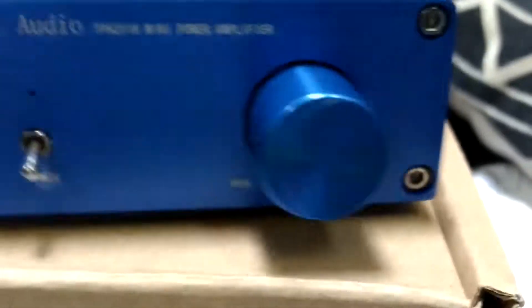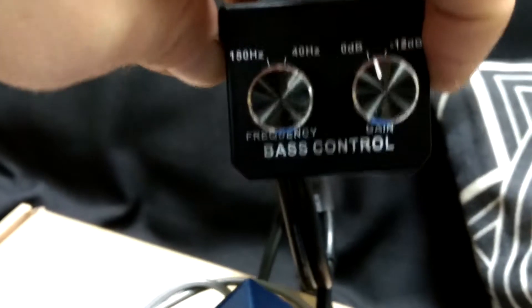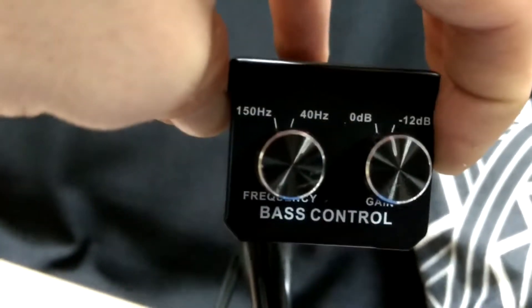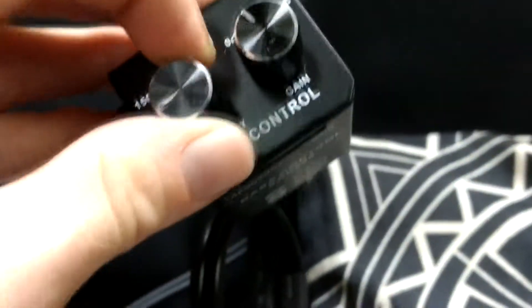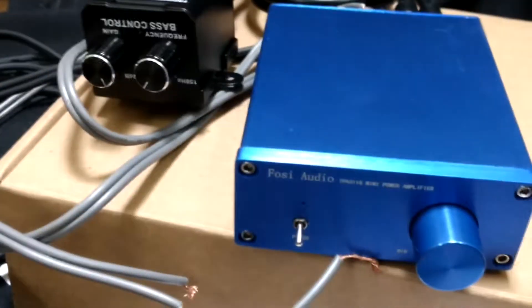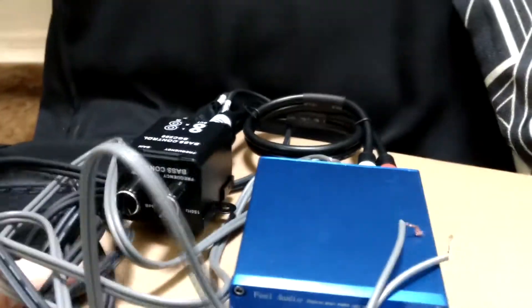This is just a normal amplifier. If you have a bass amplifier, there's a good chance you won't need this second component, which is a bass controller — basically a low-pass filter. It filters out any frequency above the set range. So if it's at 40 hertz, everything above 40 hertz gets quieter and only those lower frequencies come through. You can adjust it up to 150 hertz or whatever. You can also get fixed inline connectors that splice into the wires at a set frequency like 70 hertz — hardwired in, no adjustment. Those are cool but pretty expensive and not adjustable.